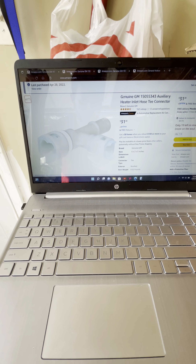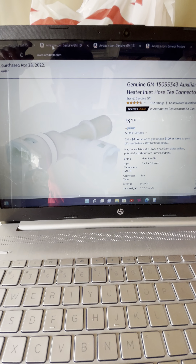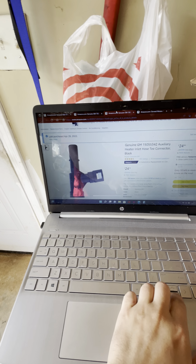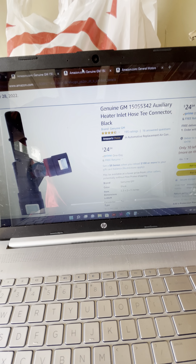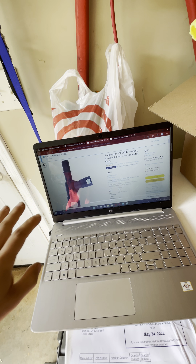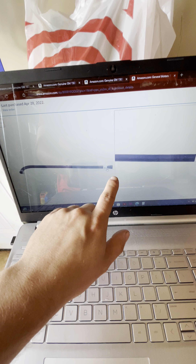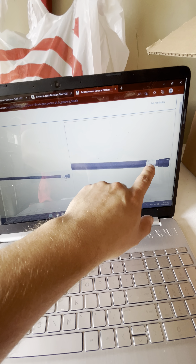This T fitting is for the heater hose that goes to the surge tank — a genuine part. I'm showing the price so you can pause the video. This other T is the one that actually broke on me. Dorman does make these and they're cheaper, but if genuine GM parts last 16 years, I'm putting genuine GM parts back on. The hose broke right at the T connector, so I still had the crimped ends left.